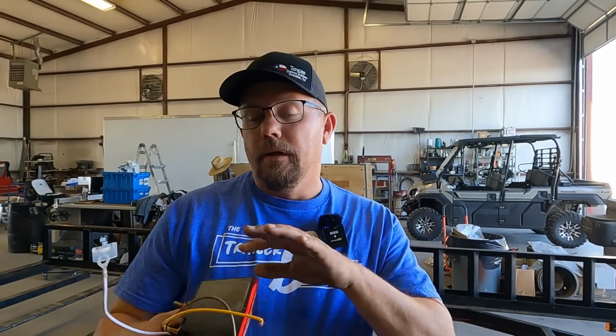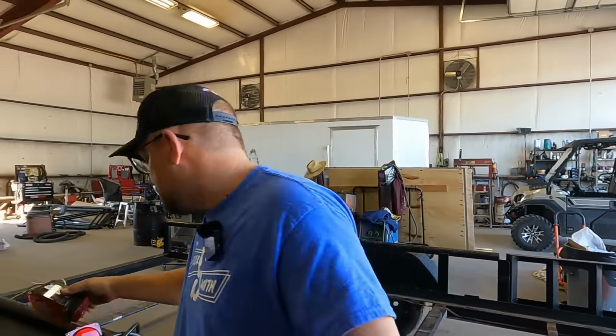Both will work. If everything's clean, if your chassis ground and all of your connection points are clean, it's gonna work just fine. I will say, in my opinion, and it's just my opinion, do what you want. If you have every light to a chassis ground, you could argue that that's more connections, more to wiggle loose, more problematic, especially on some of the aluminum stuff, or on steel if you live in a salty climate where you're gonna get some corrosion and you're gonna have a light go out, you're gonna have some light flicker. I really prefer a common ground.